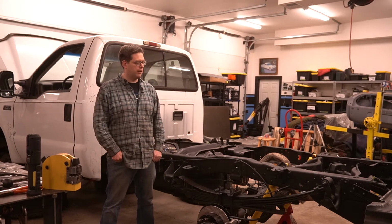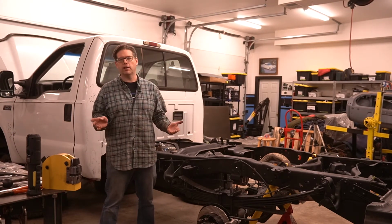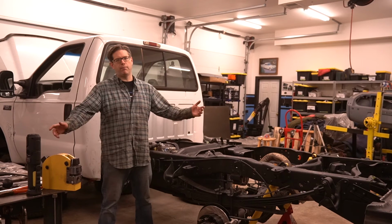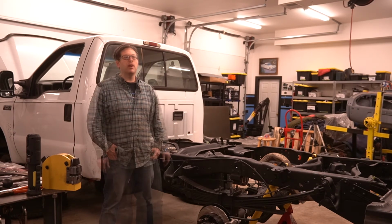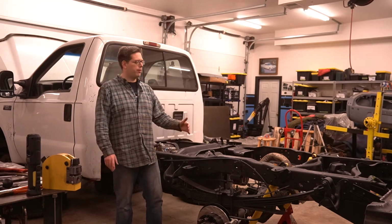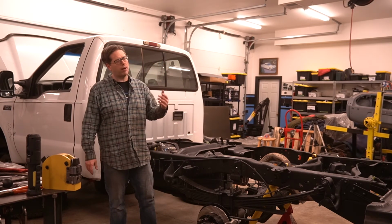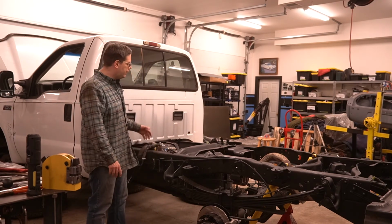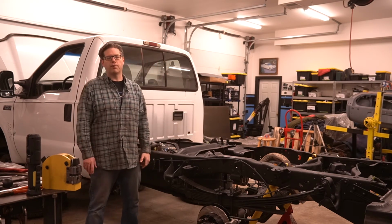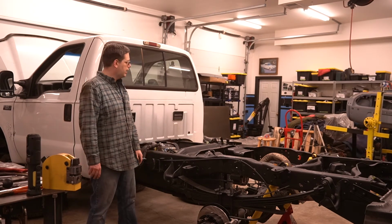But what we're going to do, you know, we can look at it one of two ways, right? We could just go ahead and try to hand form a brake line, jam it through here, get it to the other side, attach it up, and just zip tie it in and be done with it. And we'd roll it on down the road. But wherever possible, I really prefer to try to do things to match how the factory did it. So if I'm going to put a new brake line in here, I want to use the factory attachment points. I don't want that line to be rubbing against stuff. So that's what I'm going to do. I'm going to go ahead and do it properly. We're going to drop the tank, incur the wrath of the straps, and probably replace them, and just roll our eyes and say, hey, we're going to dive in pain in the ass mode and go ahead and do this.